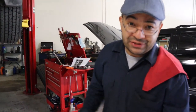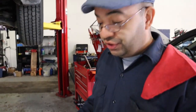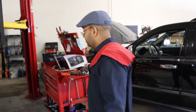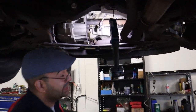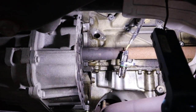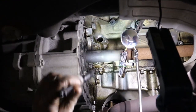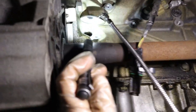Friends, you might be wondering how you're going to check that the crankshaft pickup sprocket is in position. You do it through the crankshaft position sensor hole. Come over here — as you can see, we've got the sensor out, and that right there is going to be the hole where it goes. So you grab a mirror and it's going to be right there.